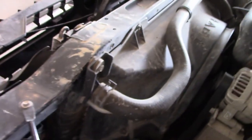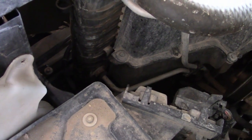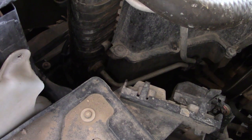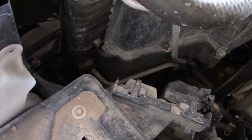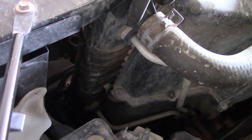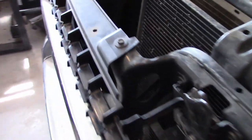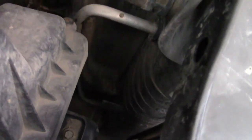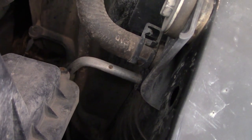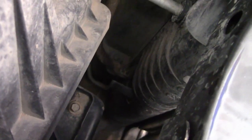I got that top cover off. Now I'm going to drain the coolant out of the bottom of the radiator — I'll look for a petcock at the bottom and drain into a catch pan, or if there isn't one I'll just unhook the lower radiator hose. This particular radiator has a transmission cooler built into it, and on the other side it has an oil cooler with more lines. All those are going to have to get disconnected, and you will end up losing some transmission fluid and some oil, so keep that in mind.